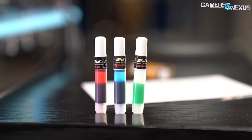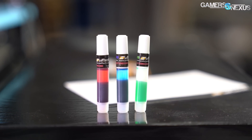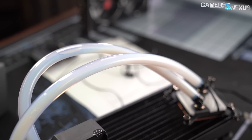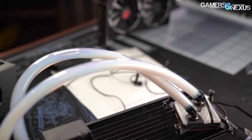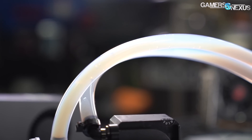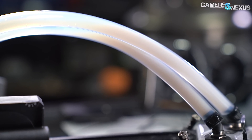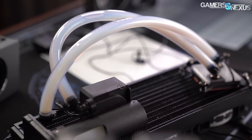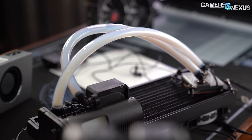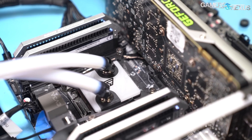Our only problem with this is a concern of aging. Coolants with color tend to gunk up over time, and after usage cycling, our review unit eventually showed the coolant and distilled water separating within the loop. We don't know the long-term endurance of this coolant. We'd prefer SwiftTech sold this unit stock with straight distilled water and maybe a biocide — or propylene glycol — and let the user add dyes or purchase pastel coolant separately. That said, we commend SwiftTech for the unique point of differentiation, though it could be executed in a way that reduces concern of gunking up the loop.